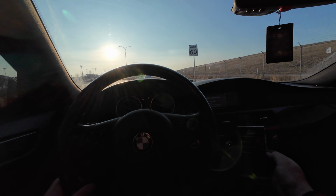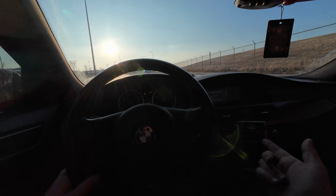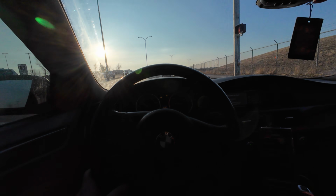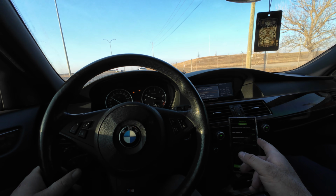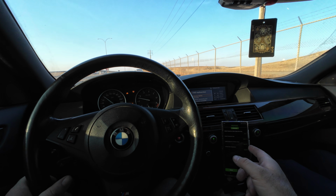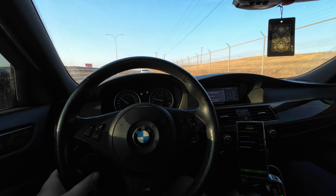So the radiator output is 209, which is good. Coolant temp on the OBD, I'm not sure exactly what that is. I mean, it went down to 221. So I think we might be okay. Now, whether that's the thermostat opening or the fan working, I guess we're going to figure it out. Coolant temperature of the OBD went down to 217, which is good. It's kind of fluctuating in between. That's sort of normal. Radiator output, 206.3. Coolant water temperature, 219. Yeah, so far so good.